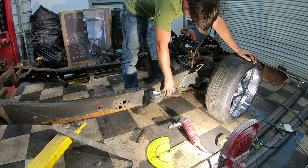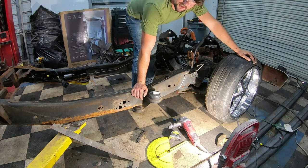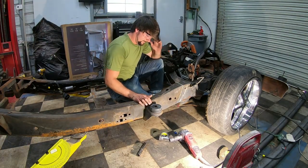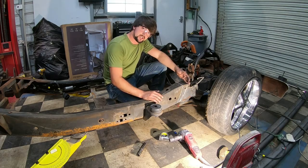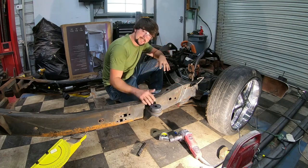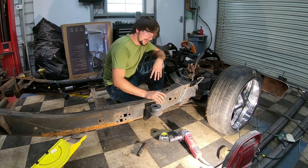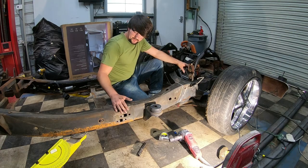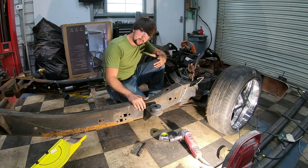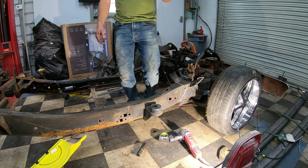I'm going to go ahead and get this cut, move it forward, and show you more in the video. After doing some more figuring and measuring, I realized it was going to bring my front end up two inches, but after checking the fender on my '66, it only needed about an inch to be moved forward. So I changed the radius on my Z and I'm going to start cutting that out. Right before I make the last cut I'll secure everything — I've still got my transmission mount in here, so that'll hold my frame from springing out or in. Even if it does spring out a little, I've got clamps to bring it in. And to keep people from commenting about it — I'm going to go ahead and get my hearing protection on.